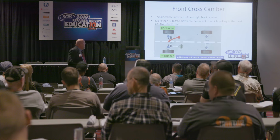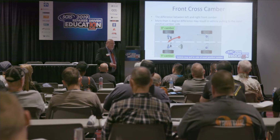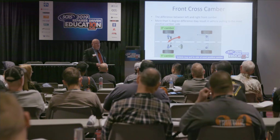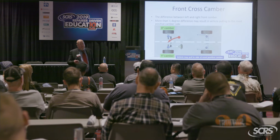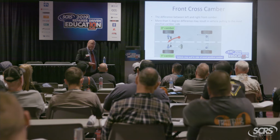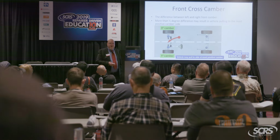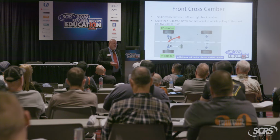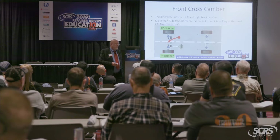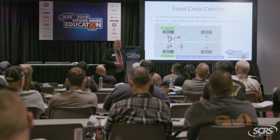All right? So any more than a half of a degree, again, is going to cause a pull to the side most positive. Now, just to let you know, there are some cars out there that are a lot more sensitive than this. The very first one I encountered was the 2003 Dodge pickup truck. When they put the 20-inch wheel package on there, that became a very sensitive platform. 4/10 is enough to make it pull, okay? So the machine will tell you through the specifications where the level of sensitivity is for cross camber.